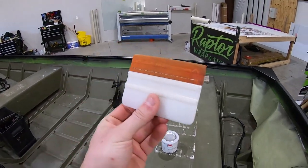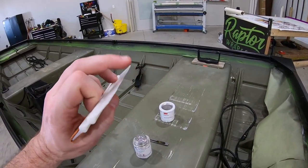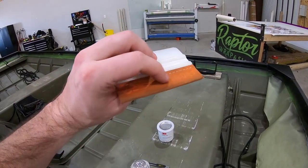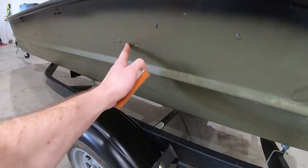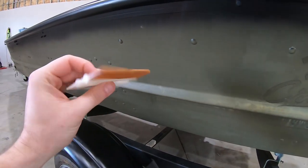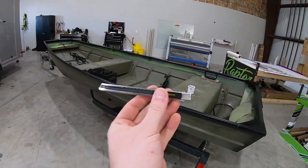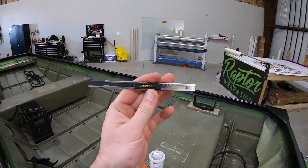The third thing you're going to need is some type of squeegee. We're going to use a felted bumper one — it's got a little hard edge so you can do some detail work if you have a bubble or a little wrinkle. It kind of helps the squeegee slide on top of the wrap a bit better, and when you're going over edges with rivets, it'll help you push that wrap down. Last but not least, you're going to want a little razor blade to trim it out. These little Olfa blades you can pick up from the hardware store or Walmart — the black carbon blades are extremely sharp and are an absolute must.